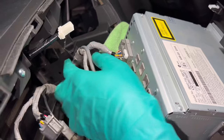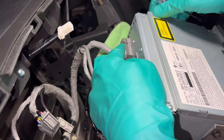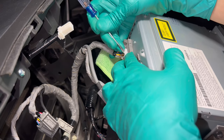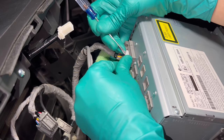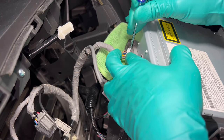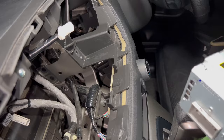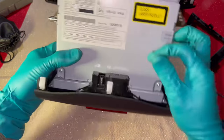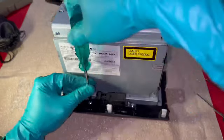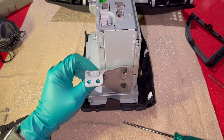This is probably one of the easiest car stereos to remove. There's one locking clip that's a bit hidden — you can press it from the front, push it down and open it up, or press it from the top and pull it out to release it. Next, remove the hazard light from the OEM head unit using a Phillips head screwdriver to loosen the screw on either side.